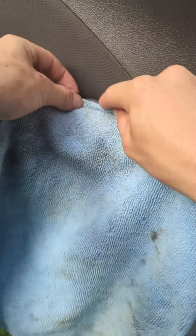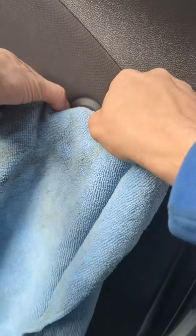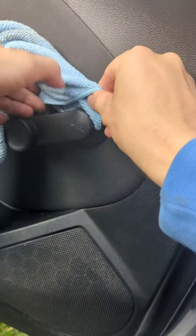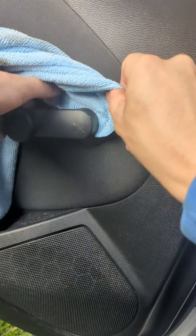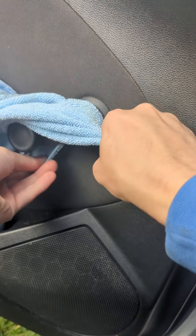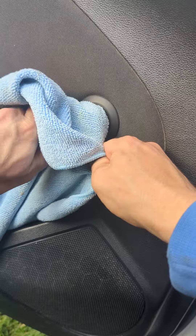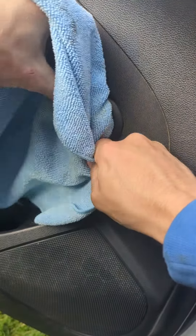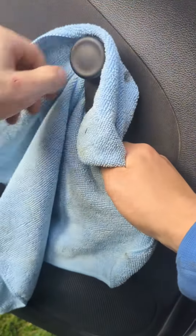You're going to feed it between the window mechanism and there's a little spacer — just move it back and forth until it's properly in there and you'll feel it sort of bottom out. So that's as much as I can get it in, and what I'm going to do is hold it and just rotate the handle back and forth until I hear that pin click.